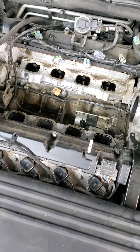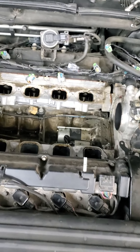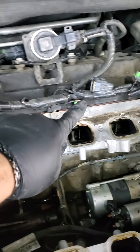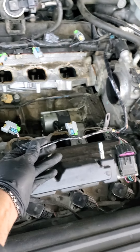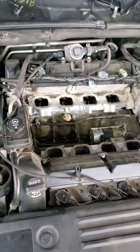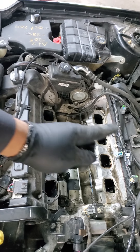The engine sight shield is usually in the way. Just over in this area is where the fuel line connects — the fuel pressure line for the fuel rail. Disconnect each one of the injector connectors. There will be another one along the front here for the front injectors, otherwise known as the left injectors. When we make reference to left and right banks on an engine, we reference the face of the engine from the rear perspective — so this is the left bank and that is the right bank.